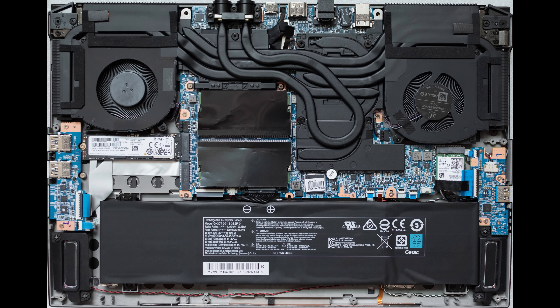Here's how the internals of the Neo 15 laptop look. There's an extra aluminum pipe that runs in from the back, allowing liquid to pass over both the CPU and GPU areas, soldered to the regular copper heat pipes underneath. Despite the extra metal pipe, nothing else appears to be missing — there's still the 93Wh battery, two Gen 4 M.2 slots, two DDR5 memory slots, and a WiFi 6 card. The additional metal pipe doesn't affect regular air cooling, and all Neo 15 laptops this year will come with the pipe built in, so you can upgrade to liquid cooling at any time.